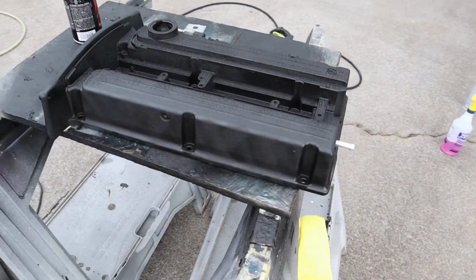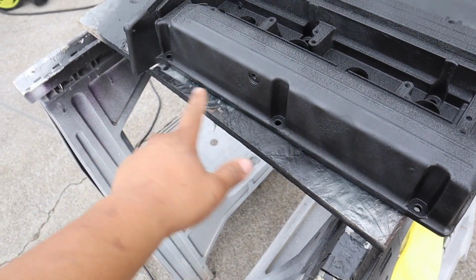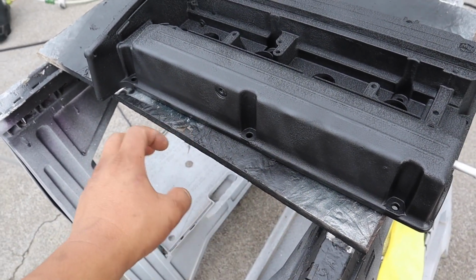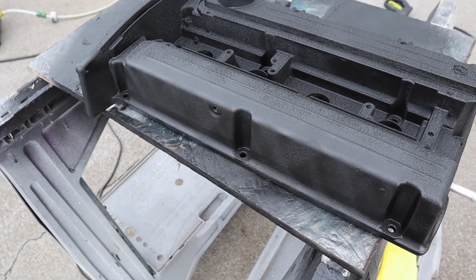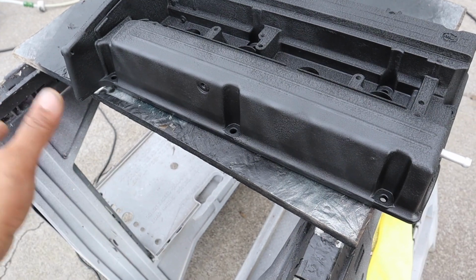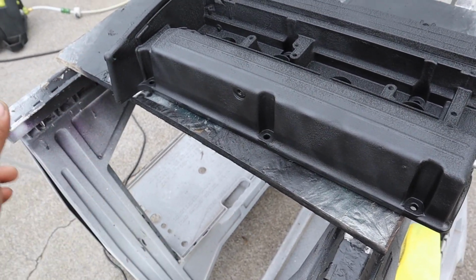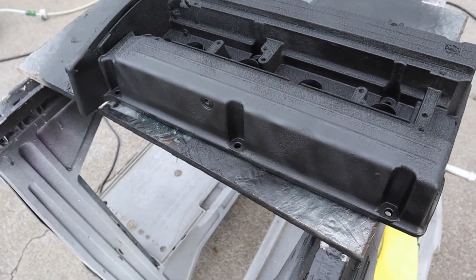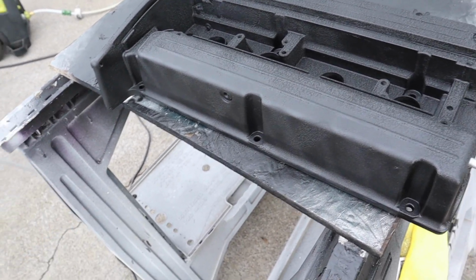Well, this is definitely not looking like what I expected it to be. I was trying to touch the front part because it wasn't getting wrinkled, so I ended up spraying it maybe 3-4 layers, letting it cure, heating with the gun. I also let it dry 5 minutes between every coat that I put, and it didn't turn out how I wanted it to be,